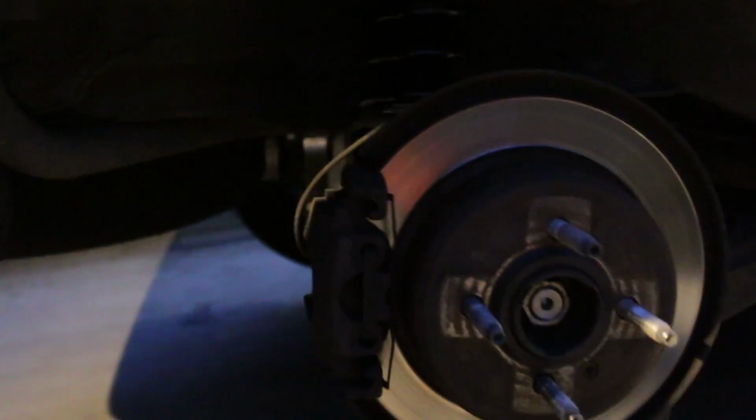Very simple install. I would say actually the competition coilovers could even be a little bit easier to install because it's really just one piece. It's really cool. Kind of changes the whole setup of the rear end of the E30, and it relieves some weight off of right here. I think probably altogether this may be a little bit lighter of a design. Not totally sure on that, I didn't weigh it beforehand. Basically, it's all working in unison, which is great, and it's got 12K springs back there, so it's gonna stay a lot more planted.